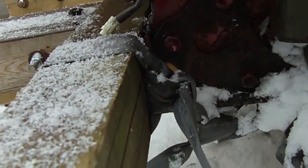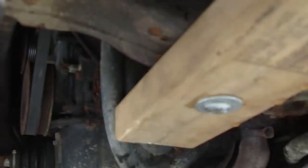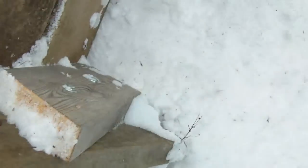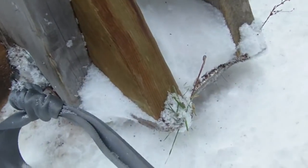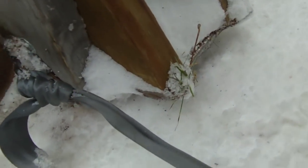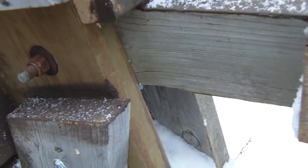Take a quick look at the construction of it. Basically these are the control arms which are attached to the car. I have a piece of quarter-inch steel angle iron on here, welded to the car, and also bolted into the rad saddle. The control arms are attached to these 4x4s, then 2x4s go up to the bracketing for the plow. The bracket on the plow is basically 2x8s going right down to the ground. The 2x6s give you the angle on the top and bottom, and in the middle it's just flat. I have pieces of steel on the bottom so it scrapes along the ground. I've screwed and bolted it together — the screws will actually break over time, so you want bolts because there's a lot of twisting going on. There are bolts in everything, and even these boards are bolted on.